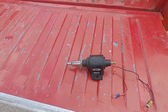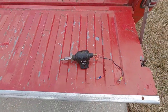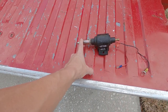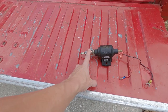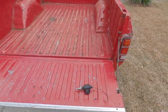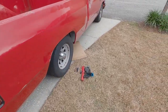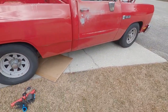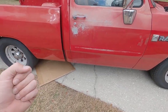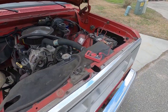Here's an example of the fuel pump I have on here — this is a Mr. Gasket unit, just an extra that I have. The problem is that this is being used as a suction feed because this was a mechanical fuel pump truck that switched over to electric. The feed line goes up and into the top of the tank, and those pumps aren't really made to pull that much fuel — they're supposed to be gravity fed. So whenever the truck sits too long, it just won't pull the fuel from the tank.